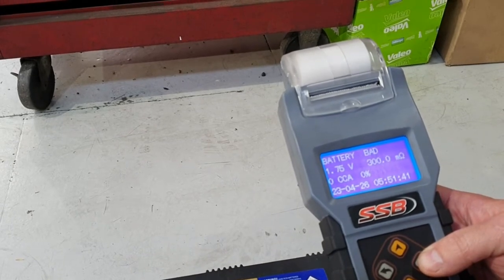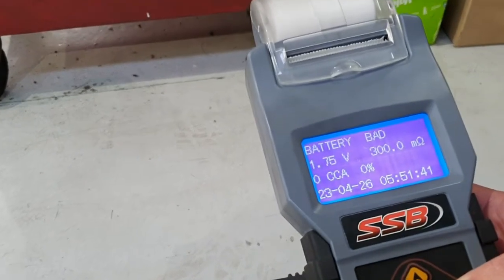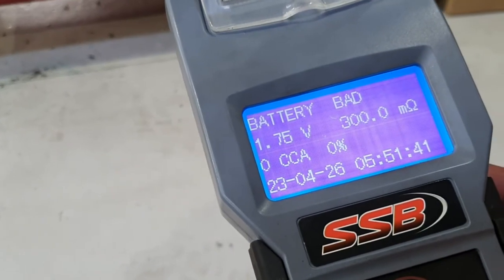So how long does a battery last? As with many questions, the answer is: it depends. A battery that is regularly discharged and then not properly recharged will not last as long as a battery that is completely recharged as part of its usage pattern. And when is it time to replace the battery? There are two ways to know. One is when your car fails to start on a Tuesday morning in winter, when it's raining, and you urgently need to be somewhere. The easier way is to load test a battery, which will let you know when a battery has passed its best and is due for replacement, before it becomes a problem.